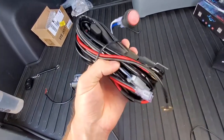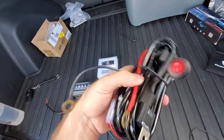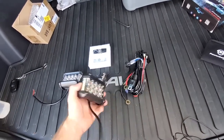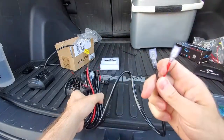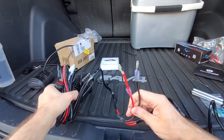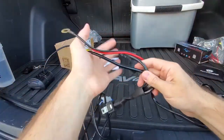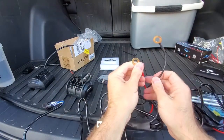Powering the lights is probably the most scary part of this build for most people, but this universal kit makes it easy since it has everything you need. This is usable for many different vehicle applications. This is also a 12 gauge wire, so it is very doable for high watt systems, even though our lights are on the low side. This wire kit is equipped with a positive and negative wire connected by spade connectors — one lead for each light. Both of these leads will go to one light on each side of the hood. As we continue down the wire, we have our inline fuse, the relay, and the terminals that connect to our battery. This is the switch that will be sent to the cabin to power on and off from inside.